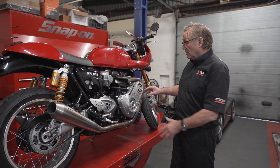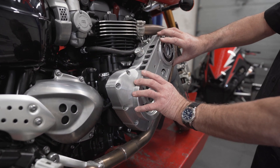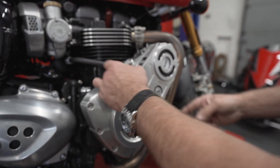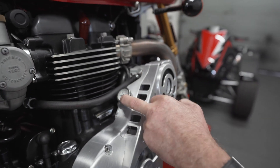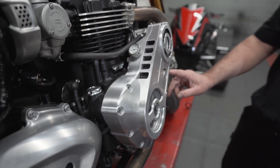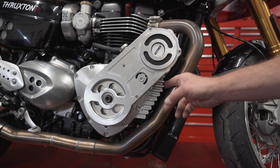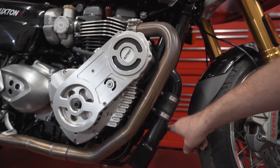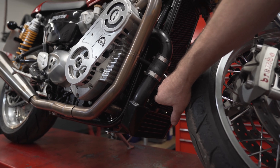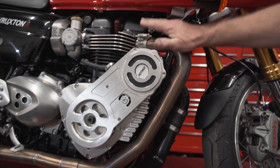It's not a bad kit to fit. We've got our own CNC machined right-hand alternator case, and the alternator case also incorporates the supercharger oil tank, so we've got a temperature gauge there and a back plate to the case. It has some finning around it — we're quite close to the exhaust but it is out in the open. We have an oil cooler at the front on top of our intercooler; the oil cooler keeps the supercharger oil cool and the intercooler keeps the air cool to make more horsepower in the engine.